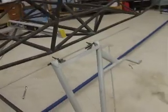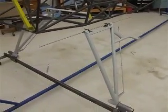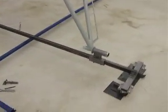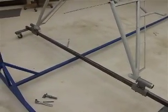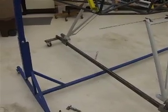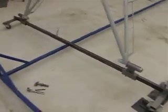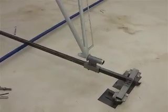So the problem I ran into was trying to figure out how to adjust the fuselage and landing gear together to make that happen. I built this jig for my landing gear — I got the idea from a guy on the internet. A guy building a pacer had an industrial quality landing gear jig, and I didn't go quite as elaborate as he did, but I thank him very much for the idea. These are spaced exactly 72 inches apart on the center line of the wheel per the plans.